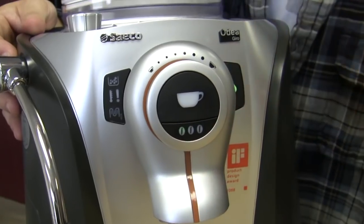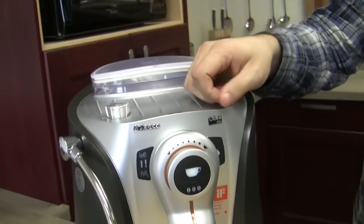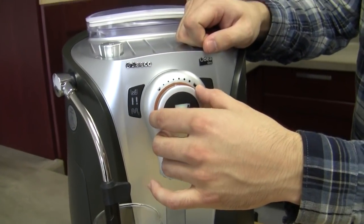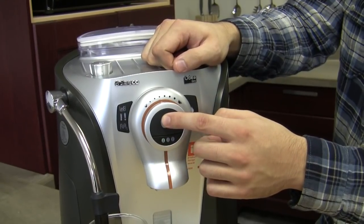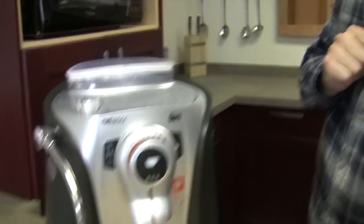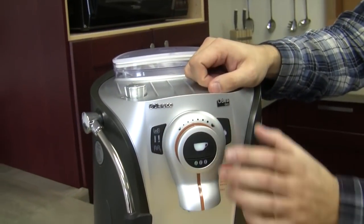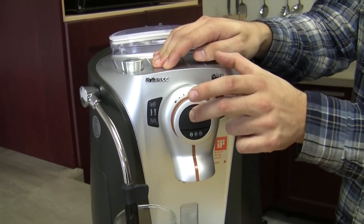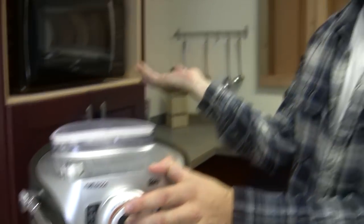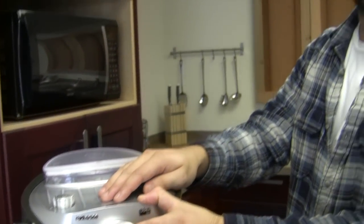It looks like everything's testing out. So right now we've tested the brew unit motor and the pump and it seems like everything's working great. I'm going to close the valve again. Now at 12 o'clock — this was for putting the brew unit back to home — now we're going to hit this. I think this is our grinder. Oh actually no — this is actually your heating element for your boiler. That's what this is testing. It's actually really hard to know if it's working or not unless you hold this down for a while. Currently my heating element is getting voltage and it's heating up the water in the boiler. So what you can do is hold this down for about 15–20 seconds, then go back to your pump, open up your water, and make sure the water coming out is very hot.